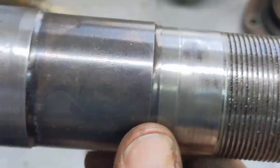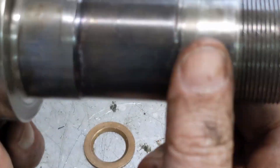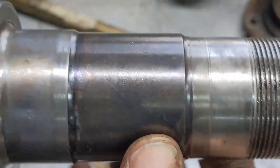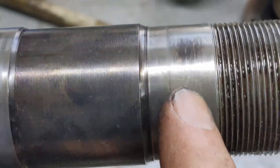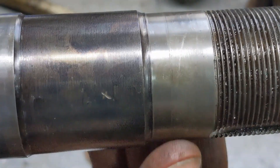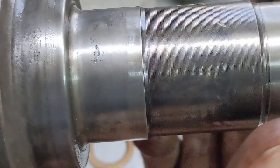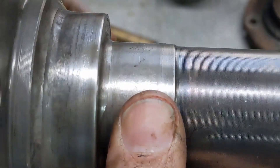Flip it over — this holds a pair of tapered roller bearings, one sits here and one sits here. If a bearing has failed and seized before, these might be all scuffed up or discolored purple. That one looks like it might have a little discoloration, but doesn't look bad. I suspect an outer bearing has failed on this before and it got hot, but not enough to do damage. The tapered roller sits in a shell and it's got an inside collar that rides on this. There's a little pitting here but it's serviceable.